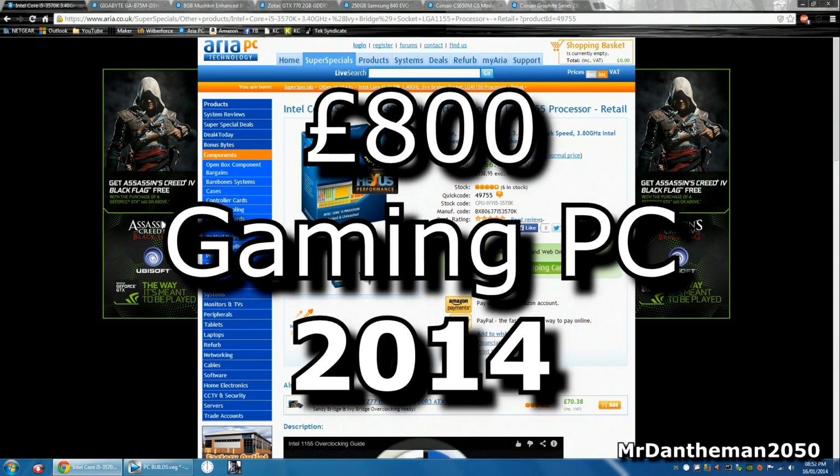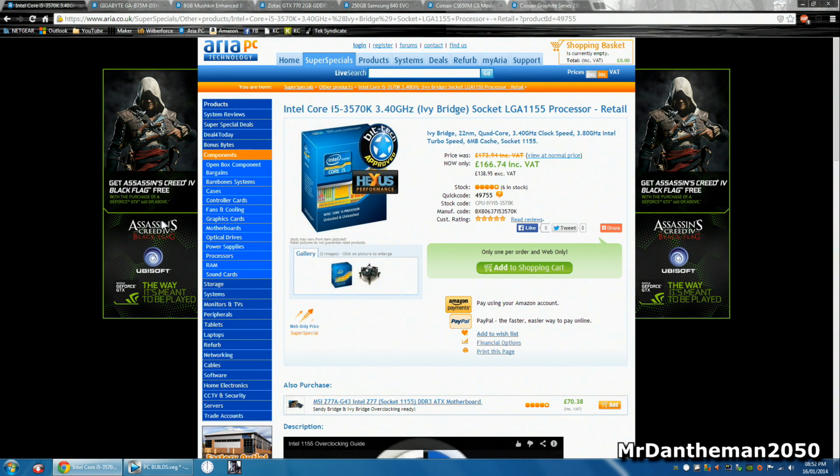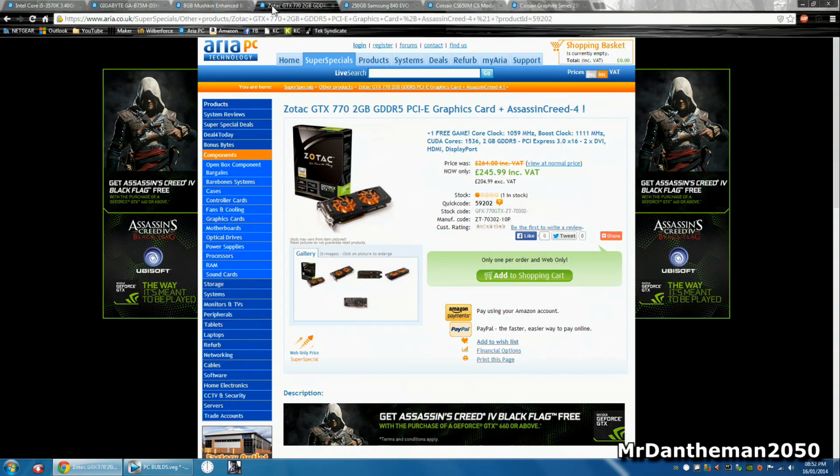The £800 gaming PC build. We're going up in £100 increments, and we've got to 800. This build is going to be really nice. We're going to be grabbing the Intel Core i5 3570K, so we're getting a K SKU of a processor so you can overclock it, and then we're going to be getting a GTX 770. 770s are really powerful, and you could expect to play any game.